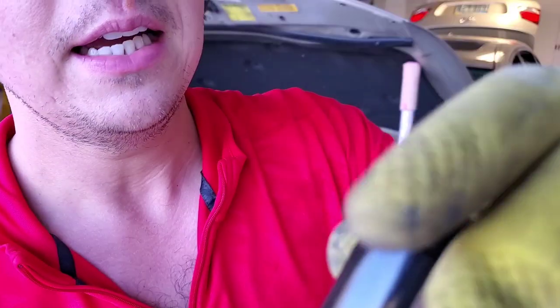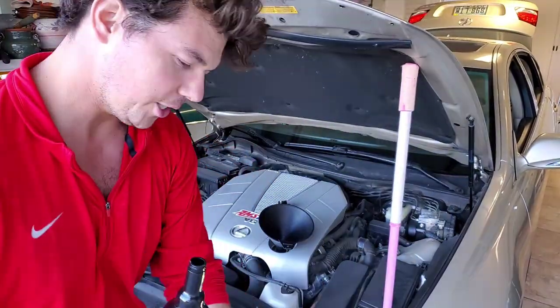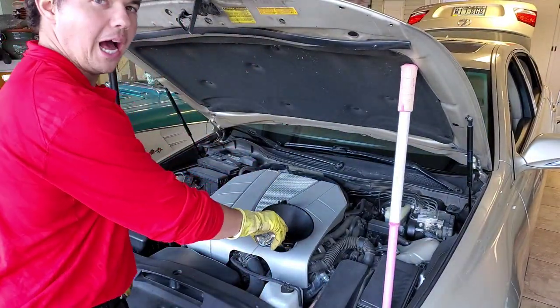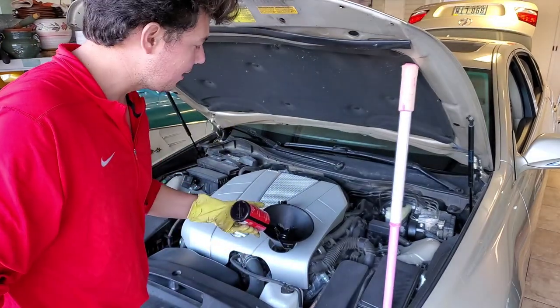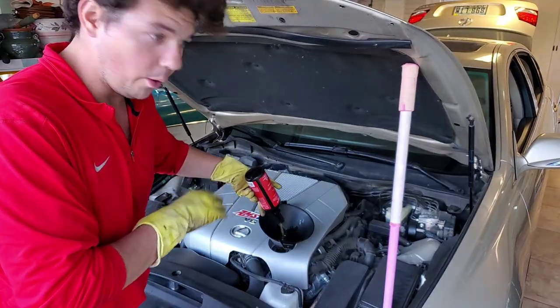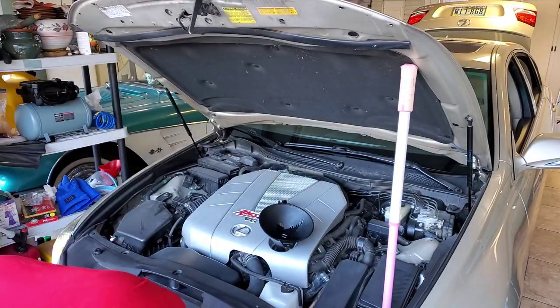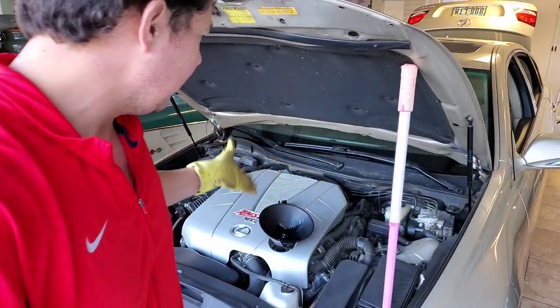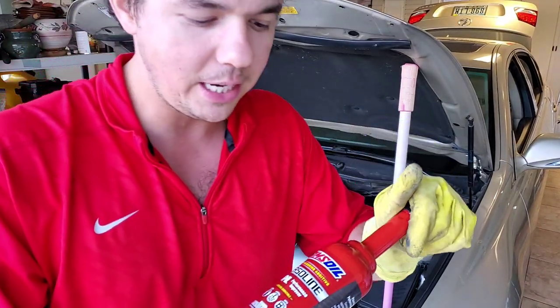All you do is taco this little flap — you push in and then you just peel sideways, just like that. And then you just dump in the flush and throw it into a good hot motor. We let this idle for about 20 minutes so it's nice and hot. This has the old motor oil in it. And we're also going to throw in the PI cleaner, so it's going to clean the valves as we clean inside the motor, in the crankcase, while cleaning the fuel injectors at the same time.